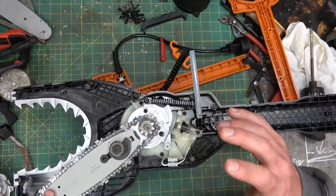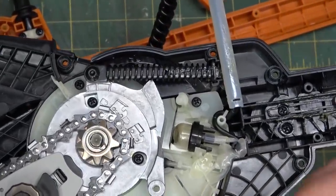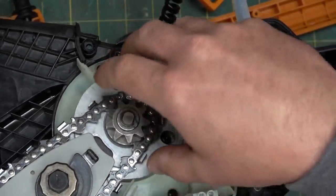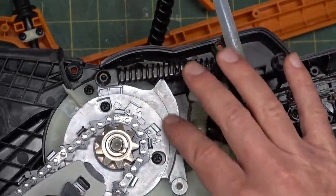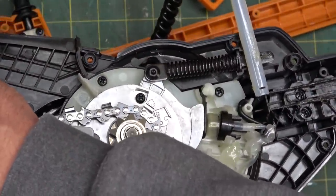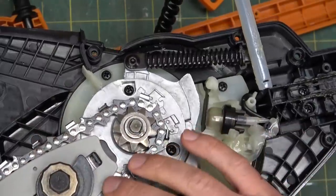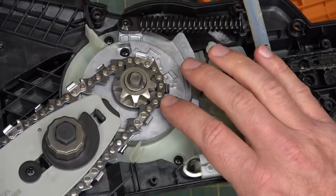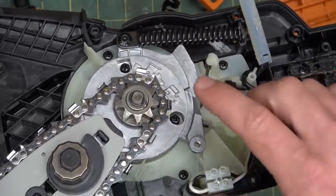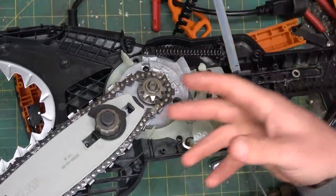The other thing is they have interesting and cheap solutions to technical problems. Have a look at this. What we've got is a gas priming bulb, just like on a carburetor on a two-stroke internal combustion engine. And in this Zamak gear reducer enclosure, they've cast a cam. So every time you actuate this thing, it plunges the bulb, and the bulb pumps the lubricating oil to the chain. So you do not want to be running this without actuating it back and forth often, because you'll run out of lube. Here's the tensioning mechanism, also rather novel.